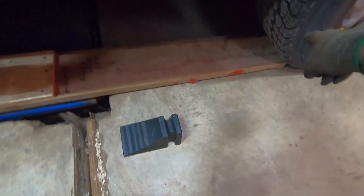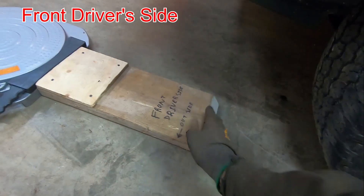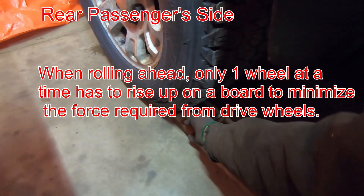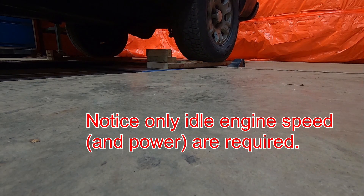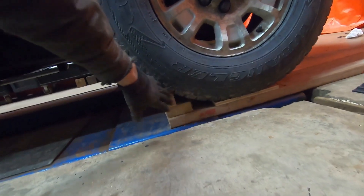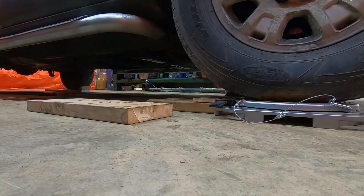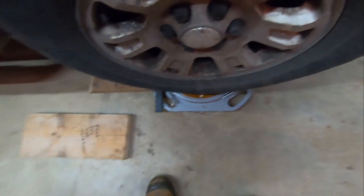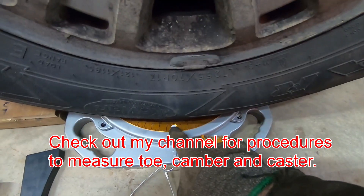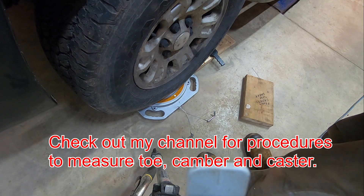Back here, this is the full-length ramp — you drive on and rise up to two inches, and there's a stopper right here. I'll remove this spacer, this spacer, and this short spacer. The back wheel came up and I could feel it come up against the stop. I'm going to take the wheel chock and put it back there so the vehicle won't roll. You see this side? Perfectly lined up at the center of that turn plate, and we're aligned center this way as well. The next thing is to remove these pins — see how easy those pins are to remove using this method? Then we'll be able to take our caster and camber measurement.